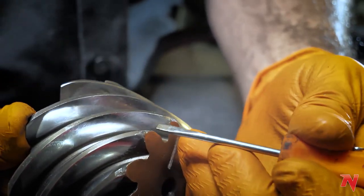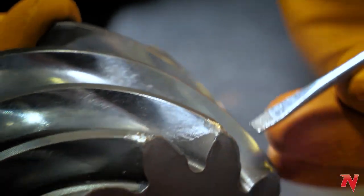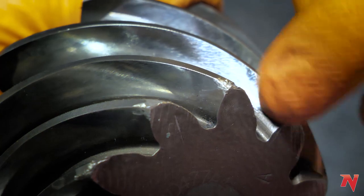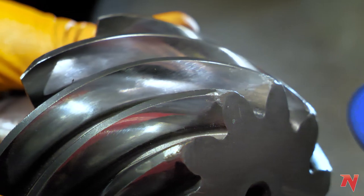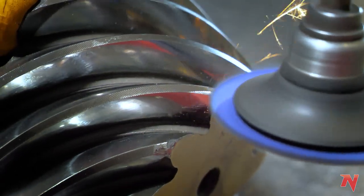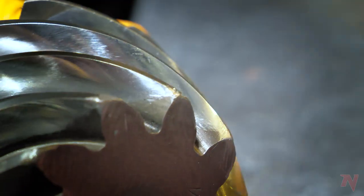On this one, it looks like it made contact with the cross pin — looks like the cross pin broke and it rolled around on it. These are all ugly. However, you can do the exact same to these: just clean them up, sand them down. They are a little bit just on the corner of the pattern. Just make sure there's no rough edges, nothing interfering or getting in the way. Just a little something like that, and that's still a perfectly good gear.